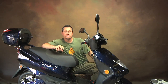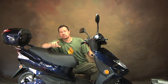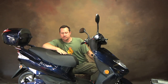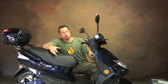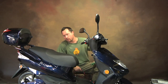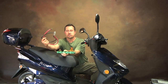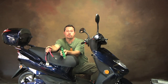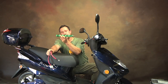The other thing that's nice about this scooter is that since it was designed for off-board charging, there's no charger built in — which is actually a good thing because it means you're not stuck with a very particular voltage or chemistry. If these were designed for lithium and I want to use nickel instead, I'm still okay because I'm going to be using a different charger. So I think what I'm going to do next is build a battery pack using a number of these nickel metal hydride sticks with a plain old Anderson disconnect, which shouldn't take very long. Stick around for next time when I build a battery pack for this scooter.